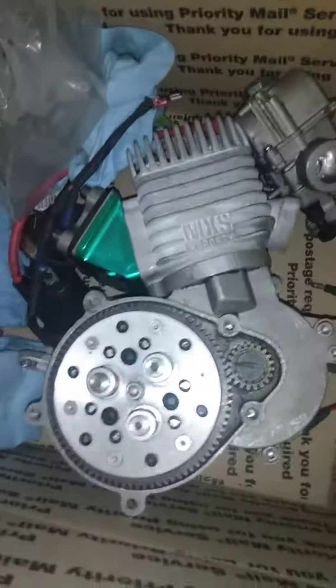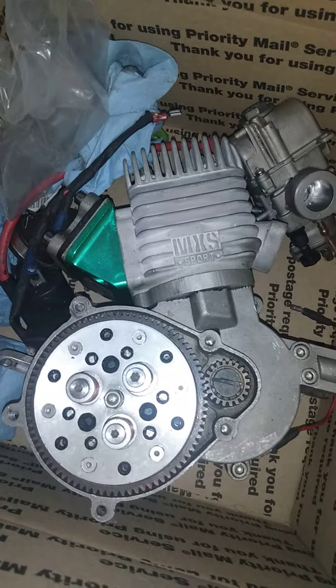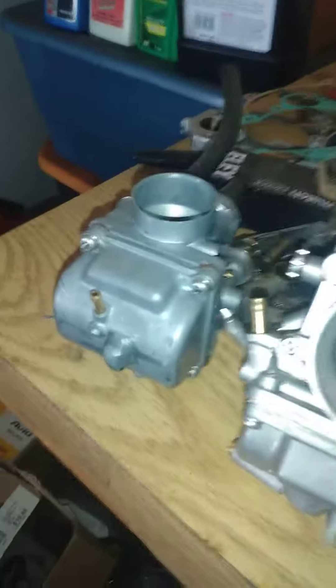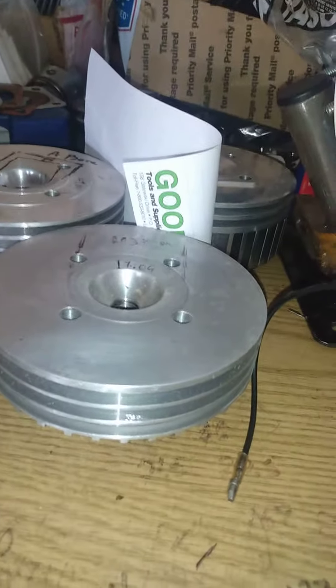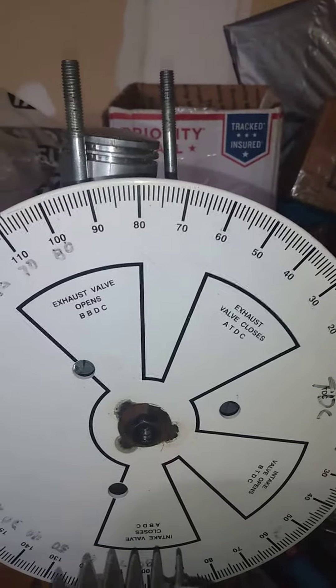Where is the point where you start getting carried away with what you build? Reliability and function — it's a simple hundred dollar motorized bicycle. Can they be reliable and make more power with minimal work? Sure they can. Get a nice little carburetor, possibly some little reeds. One thing's a must: get a decent cylinder head. The biggest part of being reliable is assembling your motor properly and setting it up properly.